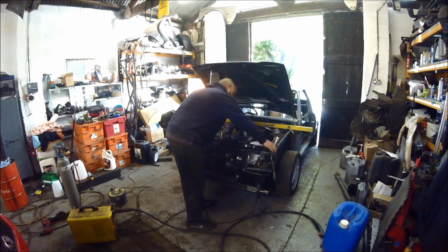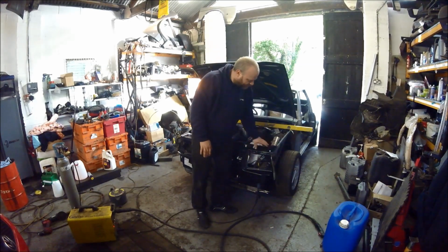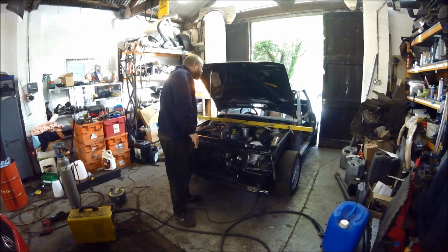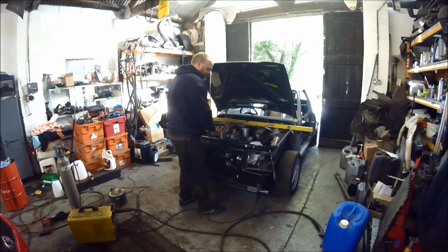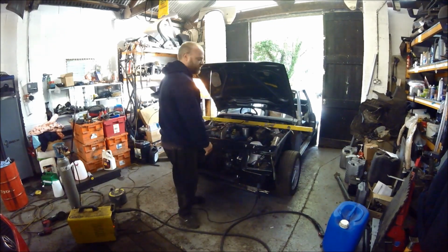The main important thing when you put a panel on is that the headlights mainly bolt to the top front panel. So do the catches for the bonnet, and you've also got these bonnet support towers that bolt in that the bonnet sits on. If you get this out of alignment, it will push the bonnet over and make the car look hideous. So you've got to make sure that this top panel is right; the rest of it doesn't really matter.